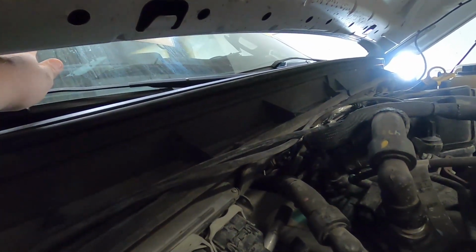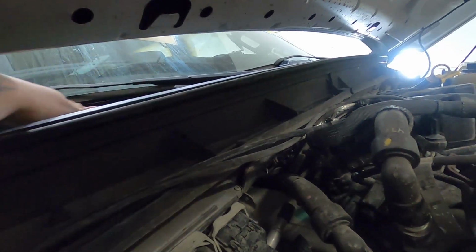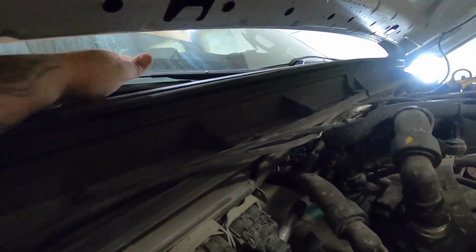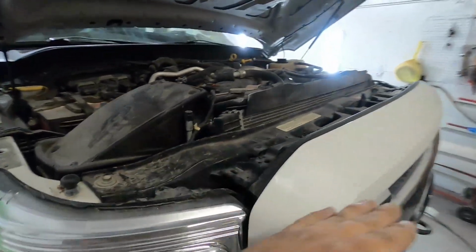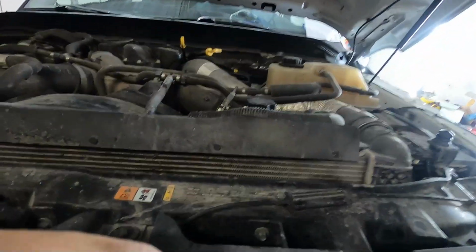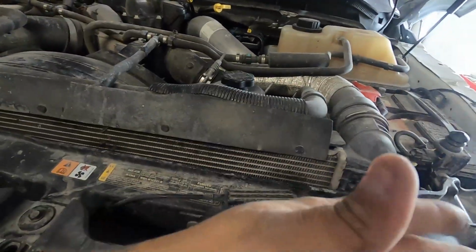We're going to tape the paper out because we're going to match it up to our windshield when we go up towards the windshield. We don't have to fold it in. It'd be kind of pointless to do that. We'd go out with it. But all along here, we don't want to come out because, of course, we have to paint out here. So we don't want paper to come out this way. So we're going to tape here. Fold the paper in, tape here, fold the paper in, just a strip all the way around, and that'll block the paint from going inside.